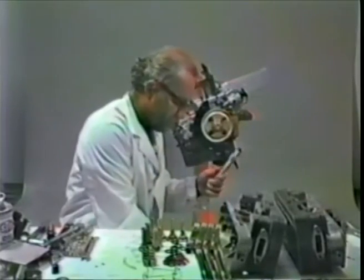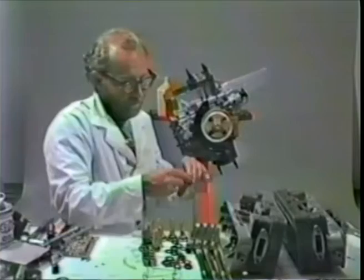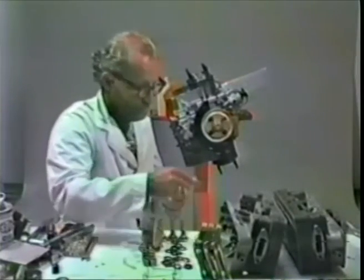So we take our finger, dip it in the secret sauce, grab a trapezoidal seal, put it over one side of the pushrod tube, grab another seal, and lubricate as we do so. The old big bore kit box serves as a good place to store all these things out of the way. And we will then do this on all 8 pushrod tubes.